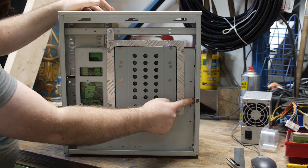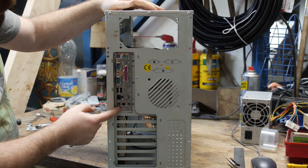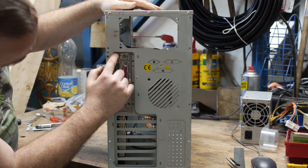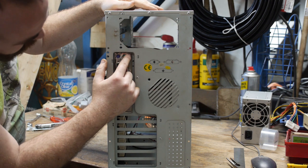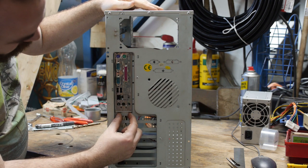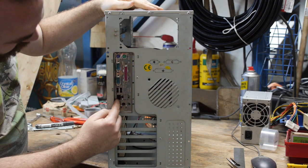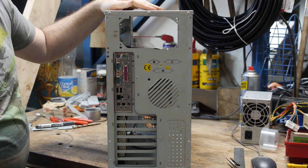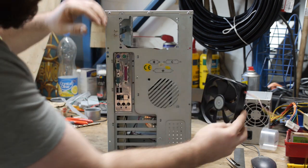The motherboard fits and is super sturdy because of the aluminium bracket with bolts and a screw that holds it in place. I found an IO shield at home and thought it would fit, but I had to cut off the top of it. I could slide it up and the ports all aligned. This works and looks better than without one. Now it's time to measure out a 12 centimeter fan hole in the back so it fits.